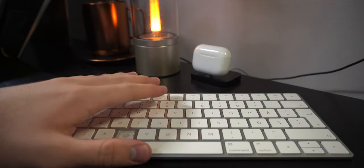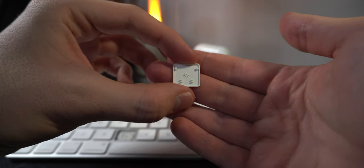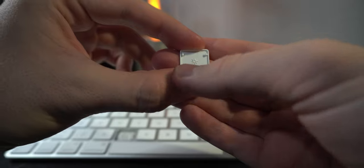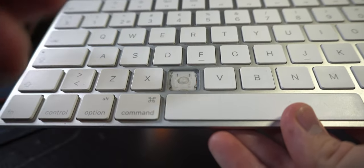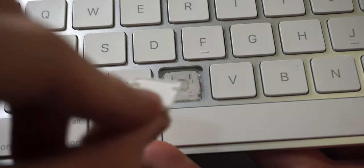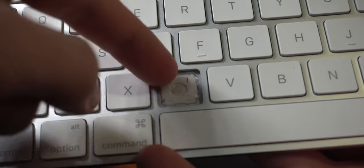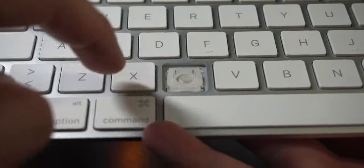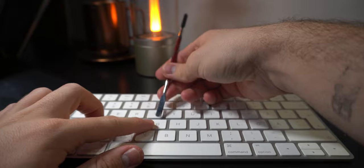Before we start, I just need to say that keyboards aren't as fragile as everyone might think. Here's the proof: there are two hooks that are holding the keycap — you can't break those that easily. But there are two plastic parts holding the part that is used to make travel between the keycap and the button, and those are more delicate. Here it is much easier to see.